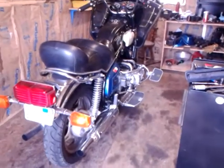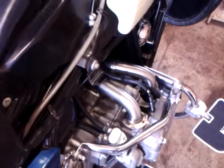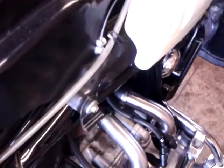I did get the issue with the number one cylinder not firing correctly corrected. The head or base gaskets for the new runners was not properly fitted over here on cylinder number one. That was the offensive character, but I've trimmed in everything pretty nice.